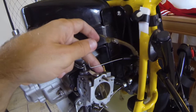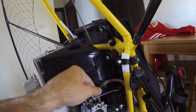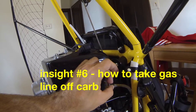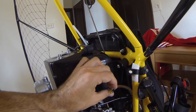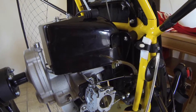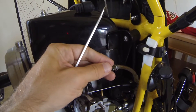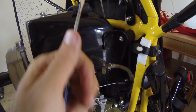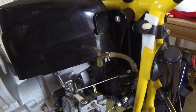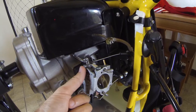This gold nipple is where the gas comes in. You can take a pliers or just squeeze it with your fingers, because this little clamp is on the end. Slide that back, and then I just took a flat head screwdriver and pried right here at the base, and this thing slipped right off — it wasn't difficult at all. Don't yank on it, just pry it up a little bit and this guy will come right off. Last thing to get off is this little guy right here, and then the carb is going to slide right off.